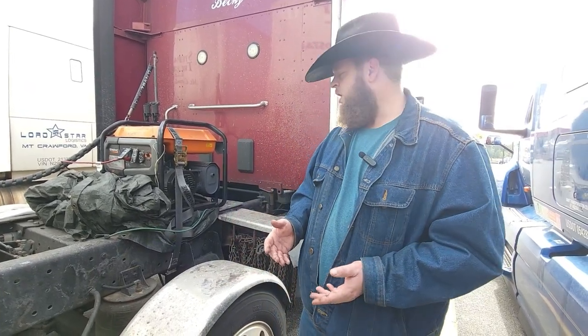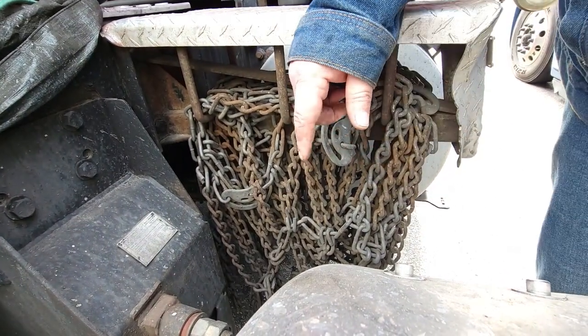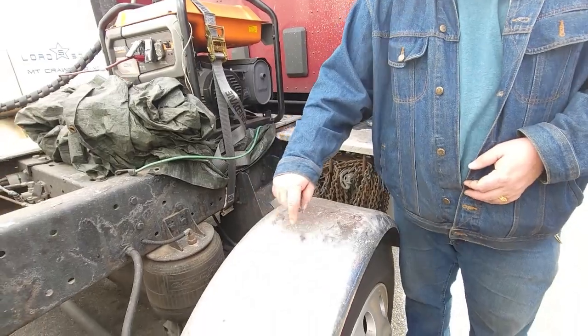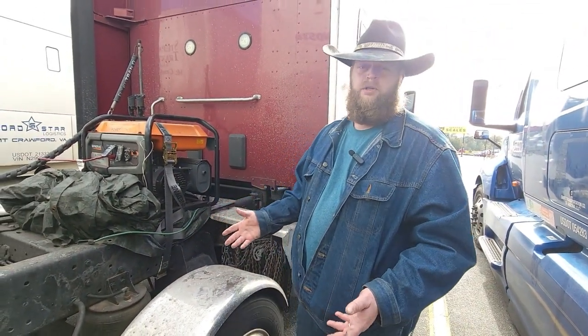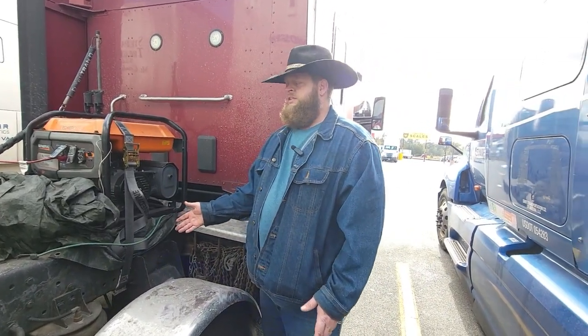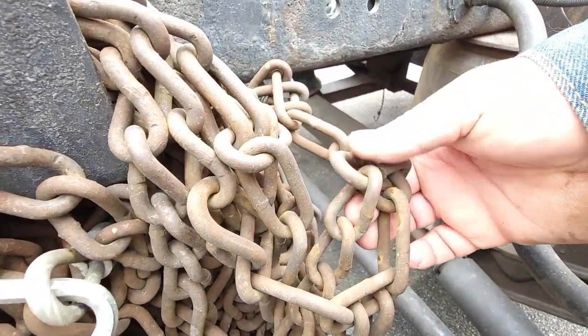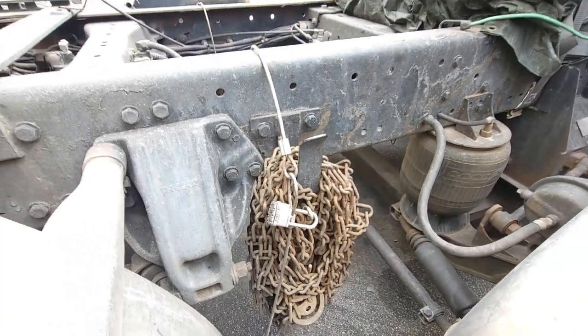With auto socks you're also limited to about 10-15 miles per hour. From personal experience, they're easy to put on and off and easy to get down a road faster, but you do end up tearing them up because you're not going to go 10 mph over the mountain. I run the camber ladder chains, as many states say you cannot run V-style chains. Ladder chains go across the tread all the way from one side to the other. V chains are for off-road — they're more aggressive at digging in and can tear up your interstate blacktop. Also important: the bent links need to be facing up, not facing your tire, because if they're against the tire they'll dig in and destroy it, causing a blowout.